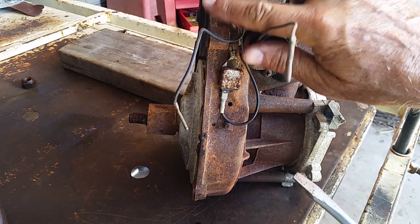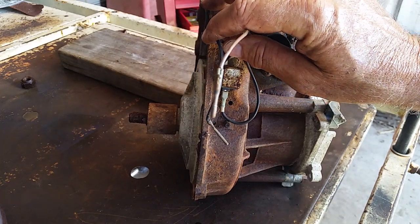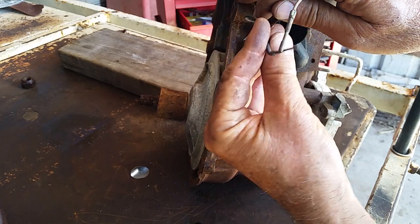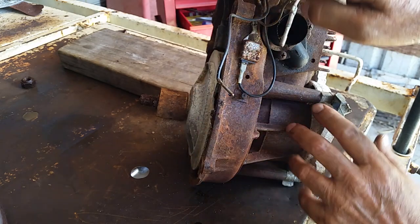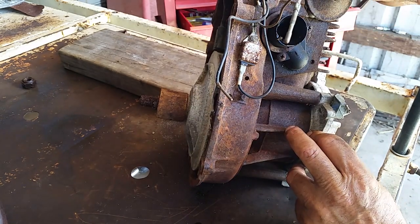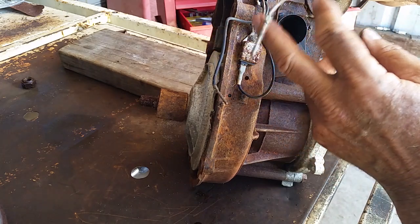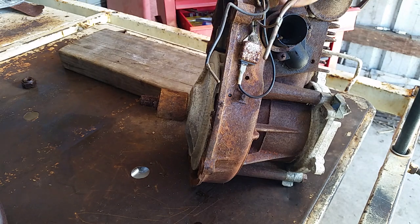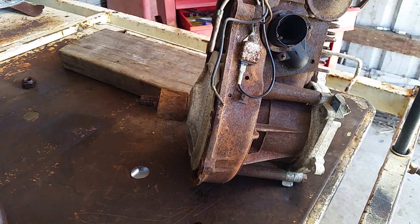These are your two kill wires that go into your carburetor, and those two meet up together in your carburetor — that's what stops your engine. So whatever reason the engine's not got a spark, it might be a problem with those two wires touching somewhere, or the insulation might have been bared. Anyhow, something to look out for.